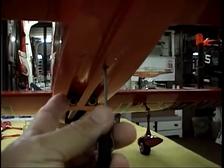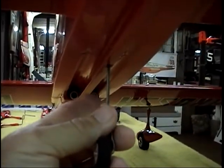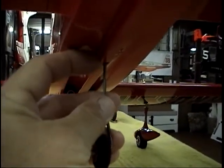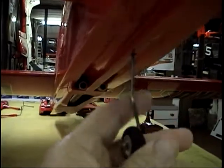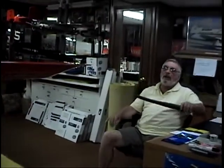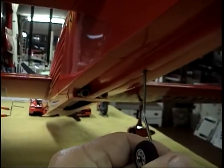I mean, I didn't know that. The problem with this is if we took these less and made little elbows, you know, those little rubber elbows? It would have been fine, but constantly back here, it just ultimately burned the paint off. Oh, yeah, that's the problem. Once you introduce the exhaust gases into a large volume of air, they cool very quickly.